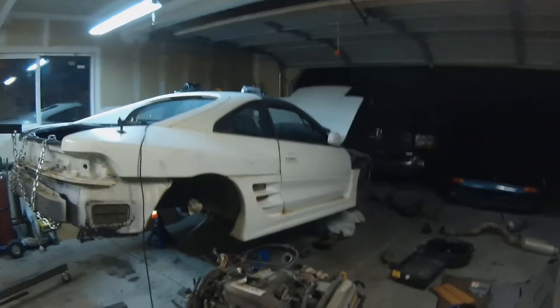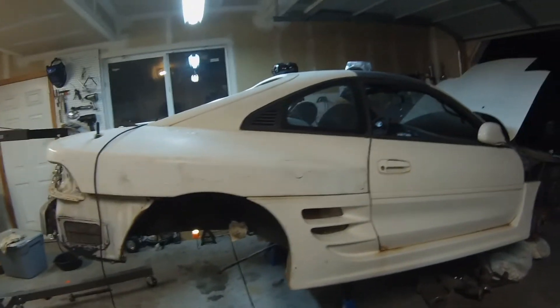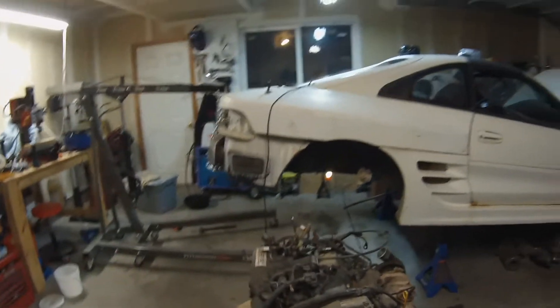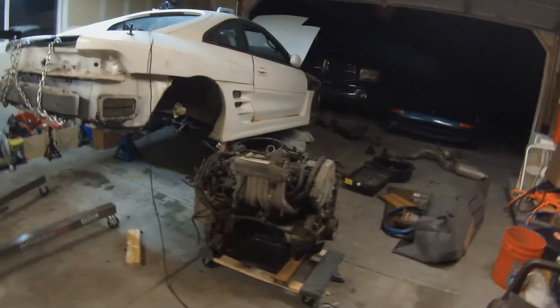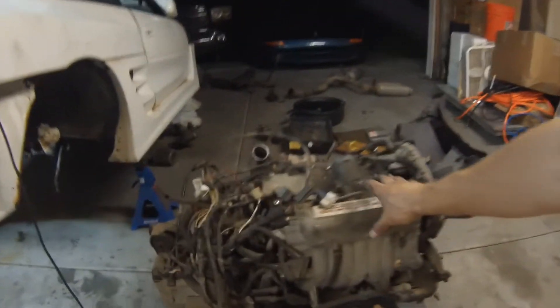For once it actually went how it's supposed to. Jacked the car up, didn't get snagged on too many things, just rolled it right out the side. That's about as high up as you've got to get this car to be able to roll that motor out on a moving dolly. The motor is balanced fairly well, just sitting on some wood and the end of the dolly. Overall everything went really well — that only took maybe half an hour once all the other stuff was disconnected. I'm pretty excited. I'm going to let this thing down and probably call it a night.